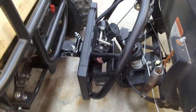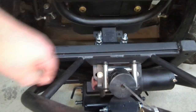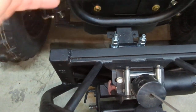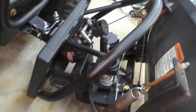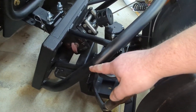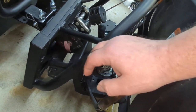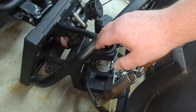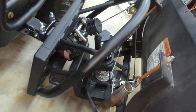So what I did was I actually sectioned seven inches out of this rectangle — cut it here, cut it there, up and down, welded it all back together. For the tube section, I actually cut it right around here, then I put some slits in this section, widened it, cut some slits in this section, opened it up, slid it over, welded it all up, grinded it, made it fancy.